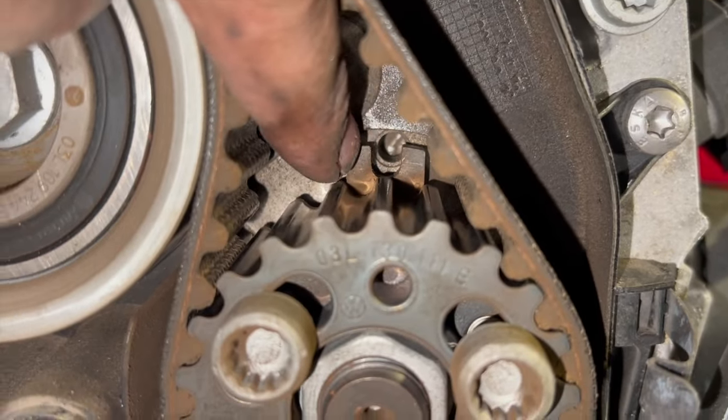You couldn't quite see it because I was focusing in there, but as I was tensioning that round and it pulls the belt taut, you could see it pull all around here and nicely tension it up all the way around the belt. The 20 newton meters is enough to remove the Allen key. Obviously just make sure that the arrow is still pointing in the middle there. Now that that's set at 20 newton meters, we could do the second stage of the torque setting, which is 45 degrees. I'll just do that quick now.